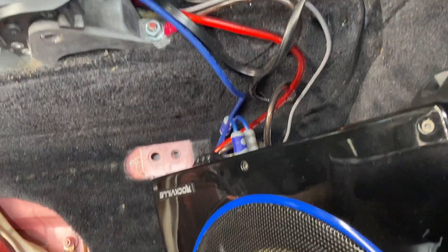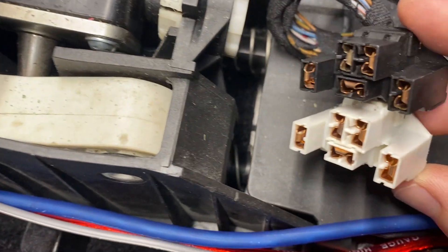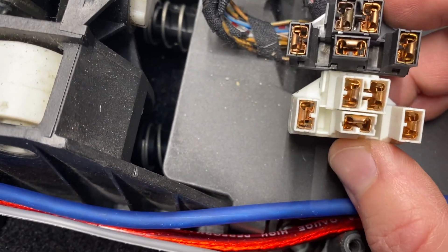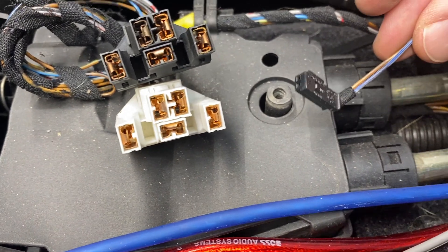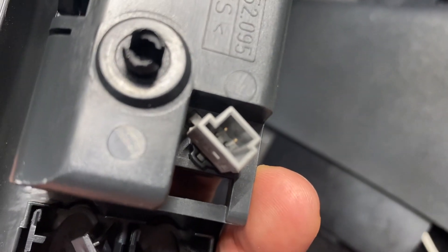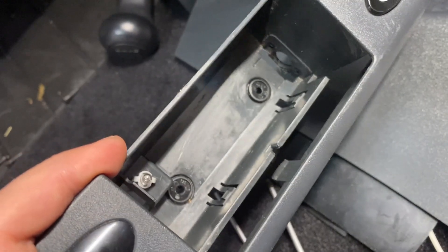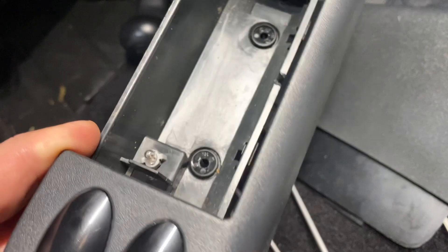You can see you probably don't have this wiring over here — that's going to my amp. You should see that these are the connectors that go to the switches for the windows, and they made similar ones that go to our heated seat switches that we kind of made by hand. There's a wire I never had plugged in, but I'm pretty sure it was supposed to be plugged into this little light right there — a light with this connector that I assume illuminates when you turn the headlights on. I'm pretty sure that's the wire we are going to splice into to illuminate these switches.